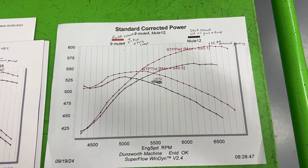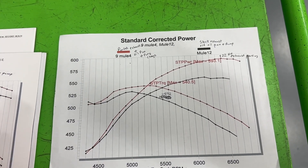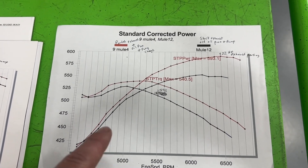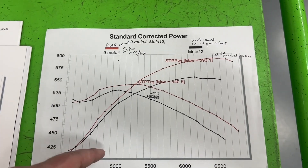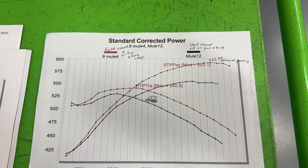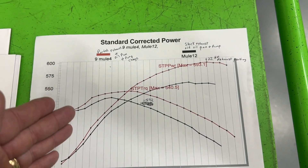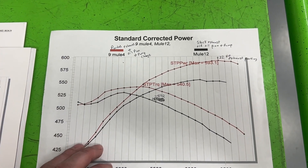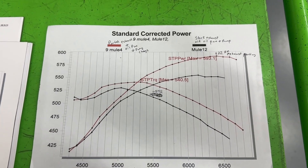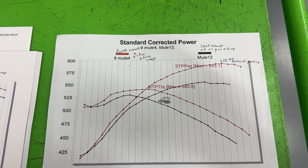Does the exhaust porting help? Yes. And I think we've been overlooking it for a long time — I have, for sure. It really makes me question: when we switched from the AFR Enforcer heads to the ProMax Project X heads, they of course flowed more on the exhaust port too. How much of that gain was from the exhaust flow more so than the intake flow? Definitely need to do more investigation, but something to think about. My rambling probably made this video longer, but hopefully it gives you guys something to think about too. Remember, I am no Superman — I do not port cast iron heads. You guys, take care.